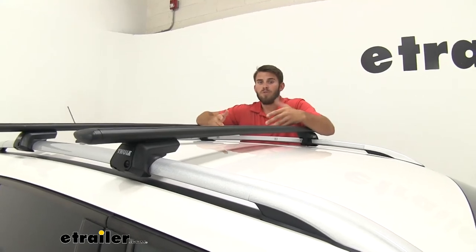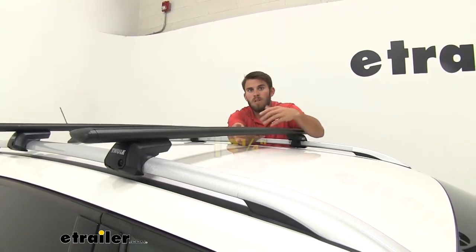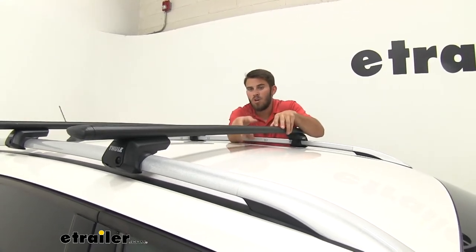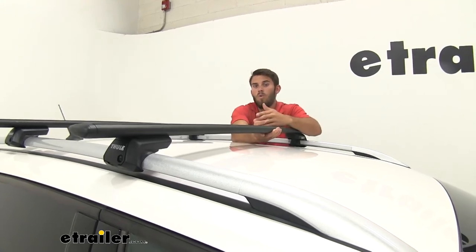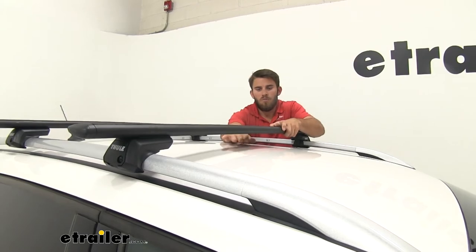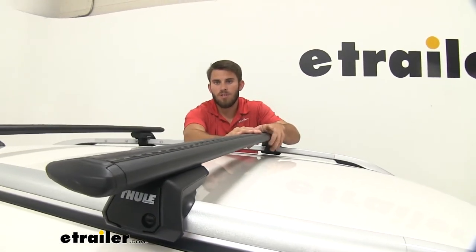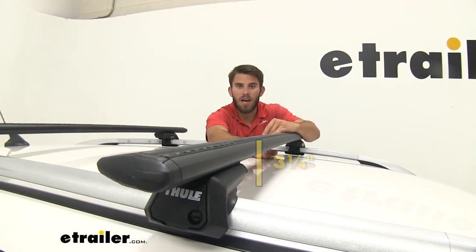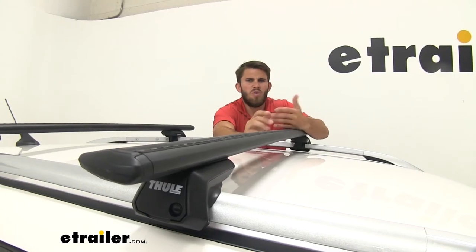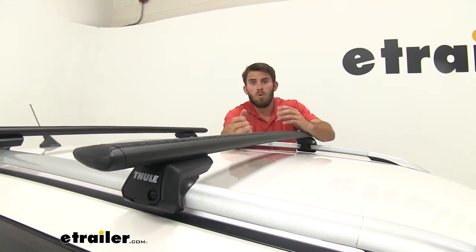I do want to go over a few measurements. From the top of our roof to the bottom of our wing bar it's going to be two and a quarter inches — that's going to be plenty of space to get your clamp-on accessories around the underside without risking damaging the top of your roof. From the top of our roof to the top of our wing bar it's going to be three and a quarter inches. Keep that in mind for any low clearance situations; you shouldn't run into too many with the Escape, but it's always something to keep in mind.